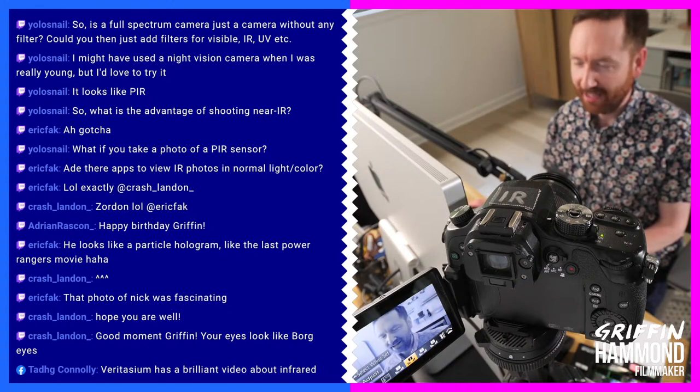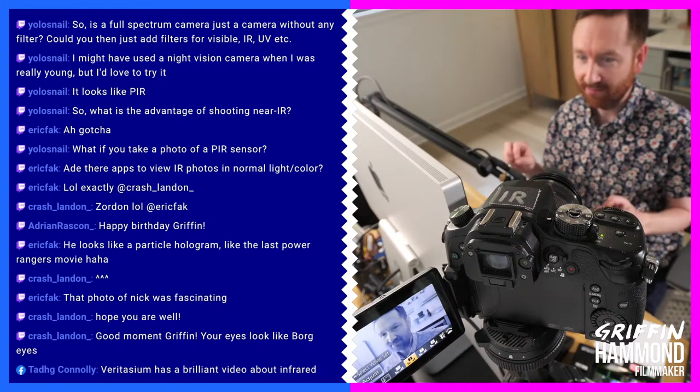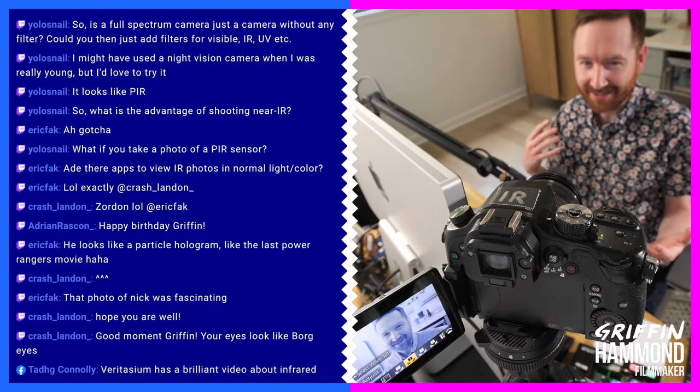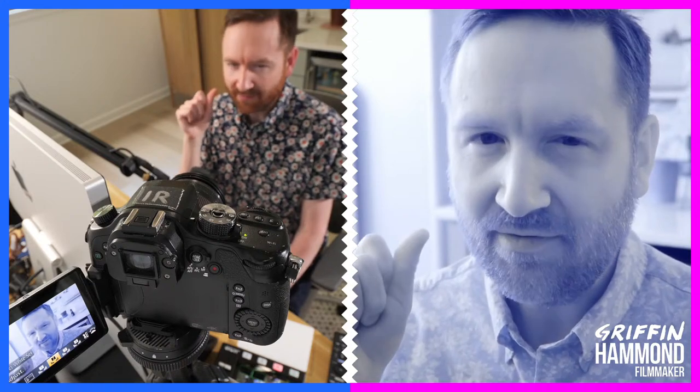Yeah, a lot of camcorders used to come with it. The way they work, I assume they're just taking advantage of the fact that their sensor is already picking up infrared and visible light. I assume the camcorder manufacturers weren't adding a whole new infrared sensor or expensive technology to these cameras. They were just going, the sensor we're already installing captures visible or infrared, so what if when it's dark, we throw an infrared lamp on the camera and it can pick that up? I'm thinking of the little Sony camcorder that I have. When you flipped on the night vision, it felt like a big physical knob happening. I bet there was a whole filter going in front of the lens or inside the sensor blocking out visible light, and then it turns on its infrared lamp.